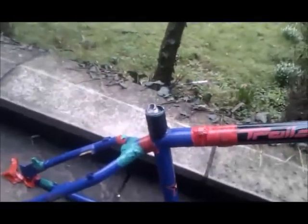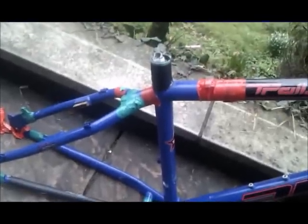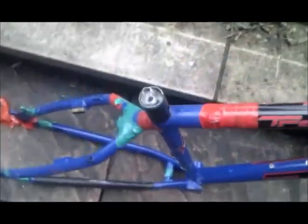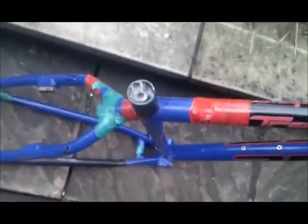This is my steel frame. You can't do this with alloy frames, mainly because the sodium hydroxide and the caustic soda will actually dissolve the alloy, but it won't touch the steel. You can see inside the frame — you can still see the rust, and it won't have cleaned it off at all.